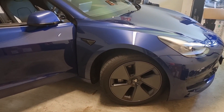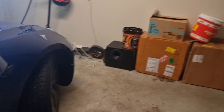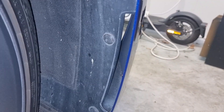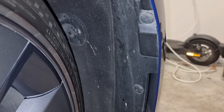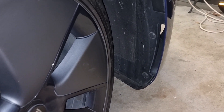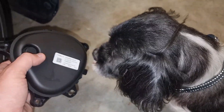The first thing you're going to need to do when you pop it in the garage is lock your wheel completely turned to the left, because you're able to do the install without taking off the wheel — provided you've got some pretty small hands. There are some clips: one, two, three clips that need to come off, and then you'll be able to get this little cover off and have a look for the wiring. You can see quite easily on this speaker that it's got a little socket there for the cable that does exist. This is a 2021 Tesla Model 3 and it does have the existing cabling.